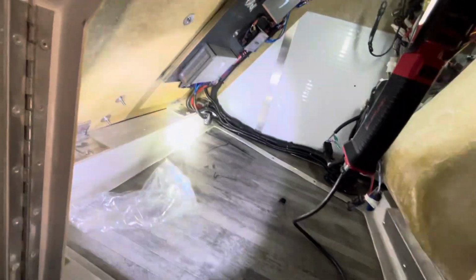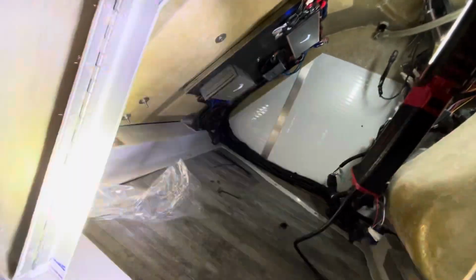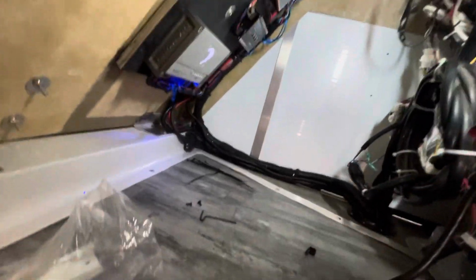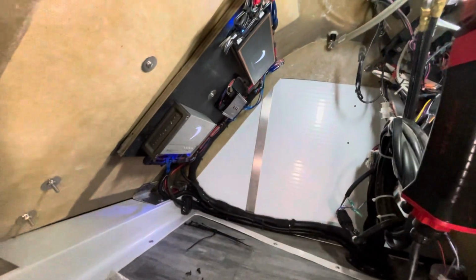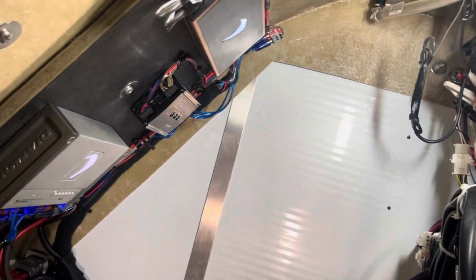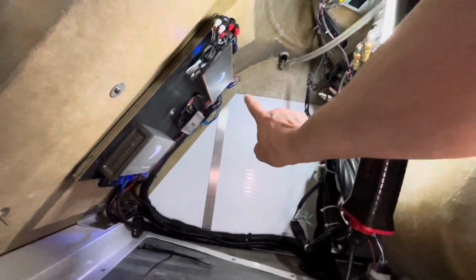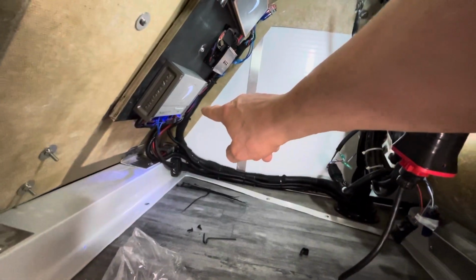So our configuration is in here. Now we don't have the bass amp fully put together. You'll see the screws and the plate around, because the customer, when he picks up this boat tomorrow, is going to listen to it and then see if he wants us to tune it a little bit differently. On the Fusion radio, we use an Audio Control LC2 to increase the RCA signal output, going into the Diamond Audio 8-channel amplifier up here, and the monoblock amp right here.